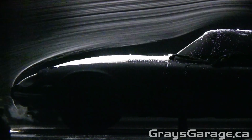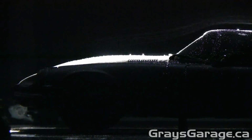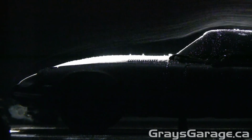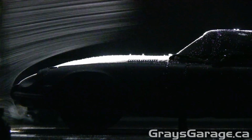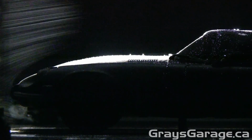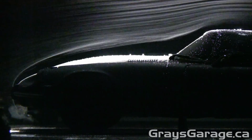Another thing I mentioned at the start of this video is that one of the editors of one of those articles mentioned that the flow moves very smoothly along the front bonnet when he looked at the rain pattern. So let's take a look here now at the front of the vehicle, and you can see that that bumper protruding does interfere with the flow a little bit. Our stagnation point appears to be at the center of that bumper, and this is low speed flow, so the flow doesn't actually reach the surface of the vehicle. We're going to move to high speed flow here in a second and see how it differs. But the flow seems to move very smoothly along the front bonnet and then be deflected around that low rake angle windshield. So let's now look at the high speed flow and compare it to this low speed.